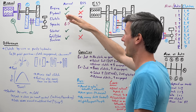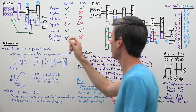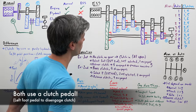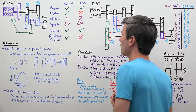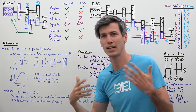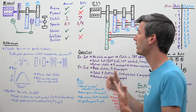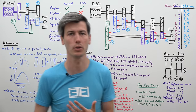A manual transmission has a single clutch — that is your disconnect between the engine and your driven wheels. With Koenigsegg you have seven clutches; anywhere I've drawn in red is a clutch within this transmission — all seven being points where you can disconnect between the engine and the driven wheels. Traditional manuals today have six to seven forward speeds plus reverse. With Koenigsegg's ESS in manual mode you have six forward gears, and in automatic mode you actually have nine forward gears.